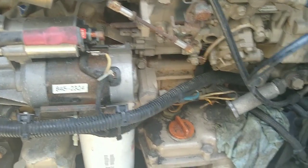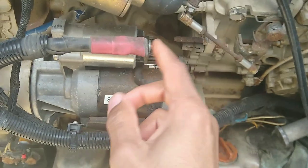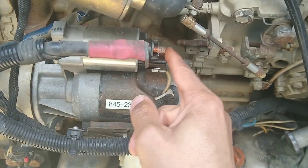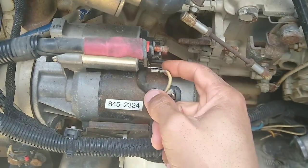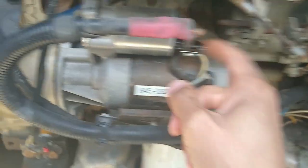I'm not 100% sure, but what I like to do when I first start working on it — I always take the positive cable off the battery. The starter is real simple. You got this wire here that's hooked up to the solenoid right here, and you got a little plug-in on the solenoid. You disconnect this power wire and disconnect this wire for the solenoid.